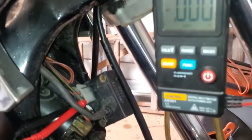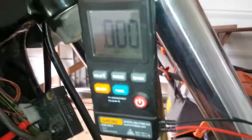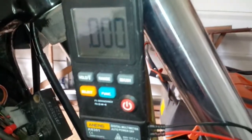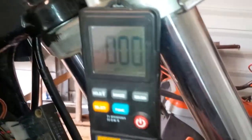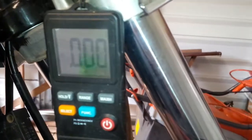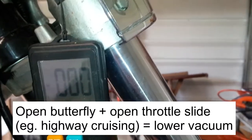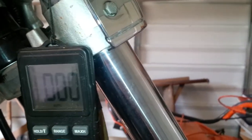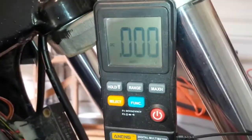This just checked out. When I yanked the throttle open and then closed it quickly, the vacuum went up because the engine was revving high and I closed the butterfly all of a sudden, pulling extra high vacuum — and you could see the number drop to a volt or even less than one volt. When you start opening the throttle and the CV diaphragm opens, the numbers come back closer to two and a half volts. When it's wide open and revving, it reads about three volts. In a high vacuum situation like engine braking, the voltage drops and signals the TCI to change the ignition timing accordingly.